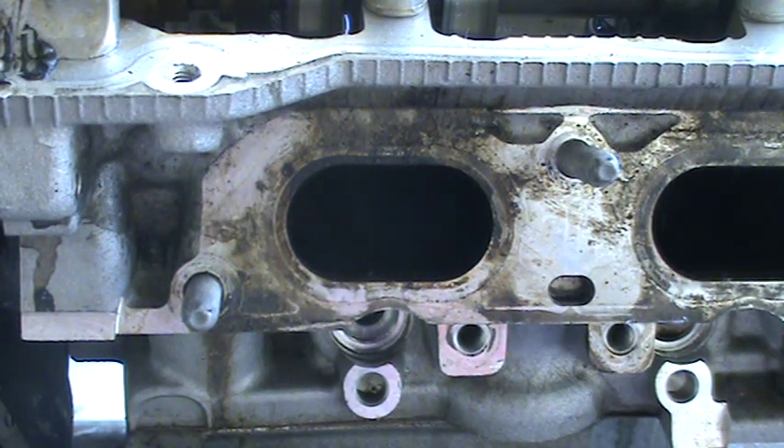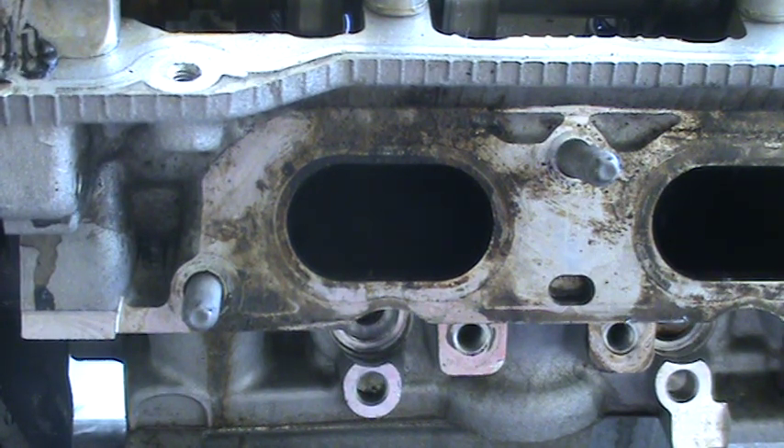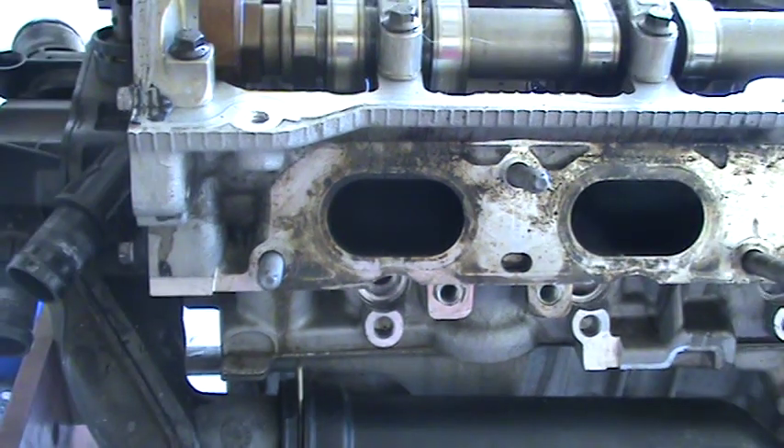Just a little FYI for you. I've seen these engines go through three quarts of oil in about 3,000 miles after an oil change. So it's very important if you have a Cooper S — the turbo motor — that you're constantly checking the oil. I'd recommend checking it every three fill-ups at the gas station just to be safe, because it can do some catastrophic damage to your engine, as I've shown in another video. Have a good day, see you guys soon!